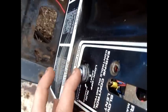Everyone's probably wondering how are we going to shut it off. I have a switch here — a tether switch, I'll show you. There's my toggle switch. There's my push button, and that's what the other side of it looks like. What I have is one wire here going to a ground on one side of the push button, and I got this one coming down, comes back, comes down through here, and I have it going right into this wire, which goes in here.